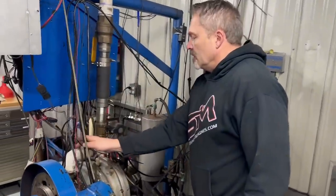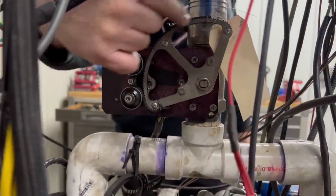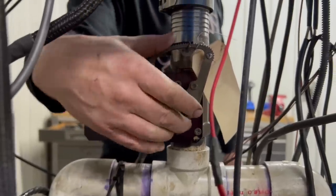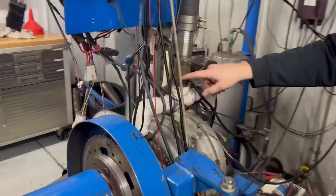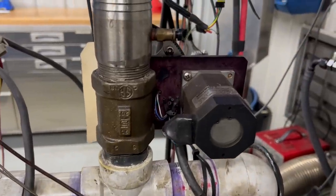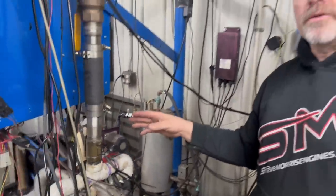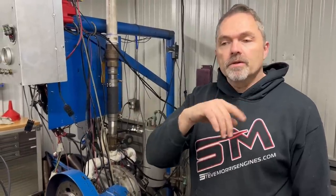So over here on the other dyno — it's a little cluttered over here — but this is the dyno control valve for this dyno. This is a d-pack setup. The stepper motor is right here and it runs through a little cog belt and a butterfly valve. It's a different type of valve — just a simple butterfly valve — and it's not a direct drive. I really like the new setup. With the d-pack stuff you can't have any controls; you just kind of set it and try to find the magic number. On the other system I can set parameters and make it respond the way I want.